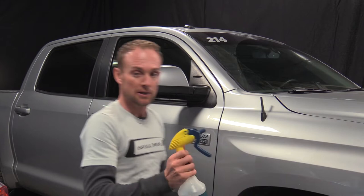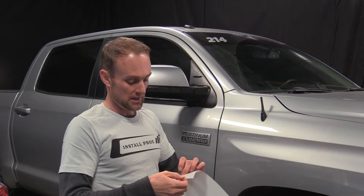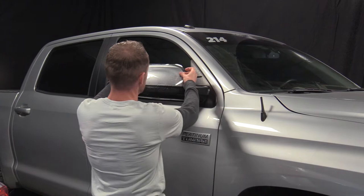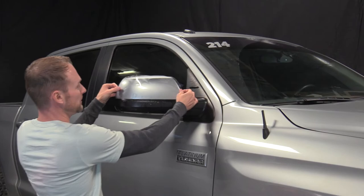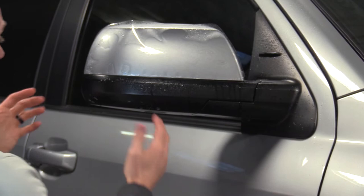The next thing you want to do is spray the surface wet. On mirrors, I'd recommend either plain water, vinegar and water 50/50, or alcohol and water. The reason is that it wets the adhesive but allows the material to tack up well and not slip around a lot — it's a small pattern, so you'll see why in a second. Right now you can move it if you pull hard, but if you stop, it's kind of not moving. That's the idea of the alcohol-water mix; with soapy water on a small mirror pattern, it would slide all over.